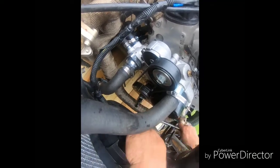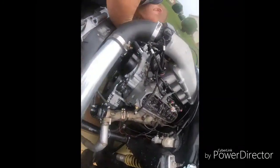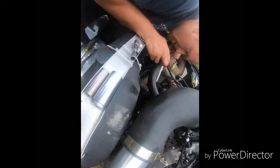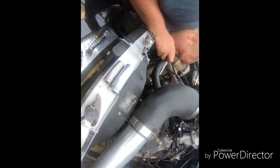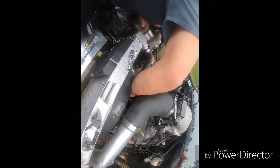It stops right there. So we're going to mark it. The point in between those two is going to be top dead center. It's on 261 degrees on one side and 281 degrees on the other. So it'll be 271 degrees right in the middle — that'll be your top dead center mark. So what I do is erase those other ones so they don't mess you up.